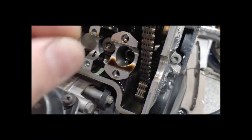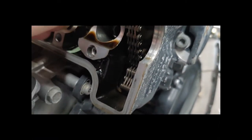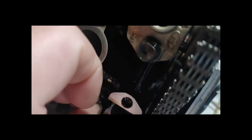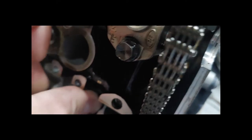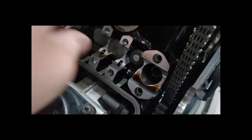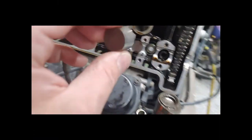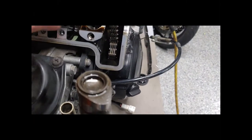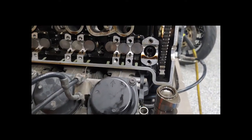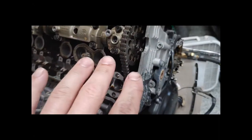I'm going to use bare hands — I don't want to drop it. I'm going to stick it right inside. This one's a little deeper than the R6, a little harder to get to, but you want to go ahead and get it till it clips just like that. Then we take our same valve bucket from that same spot and place it back over the top and push it down. That's all we got to do. We're going to do the same thing to the last two, then I'll show you how we're going to put this top end back together.